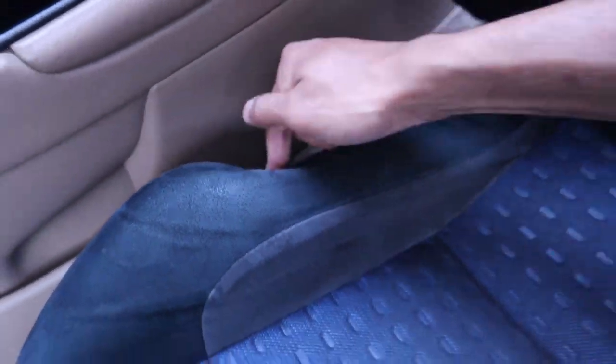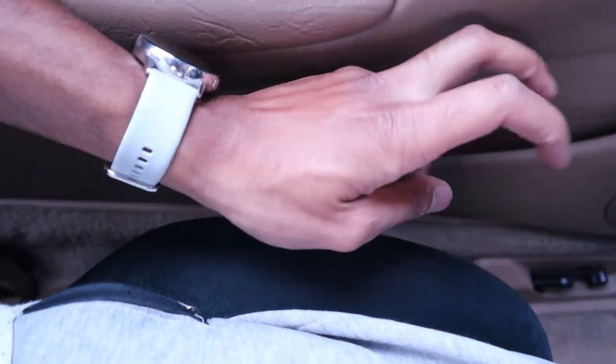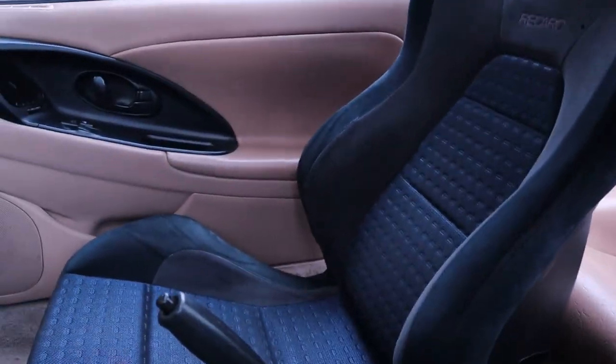Some of the Alcantara is ripped up and the bolstering is really bad on one side — that was the driver's seat from the JDM car, so for me it's basically a barely-used passenger seat, which is great. The eBay brackets were really a pain. My seat was really off when I first lined it up, so I had to play around with it. It took me personally about eight to ten hours just for the driver's seat. Zephyr helped with the passenger seat and that took maybe an hour and a half to two hours. Having someone else hold and measure things made it a lot easier. I just expanded the bottom bolt holes and made three new holes on top, and it fit really well.